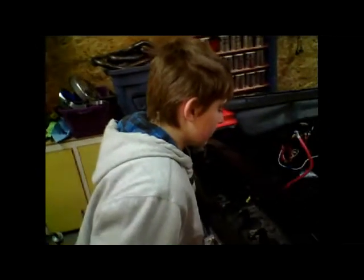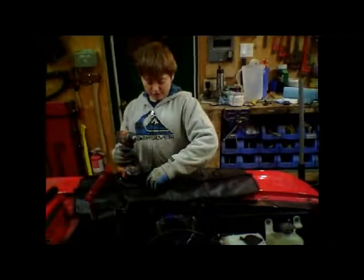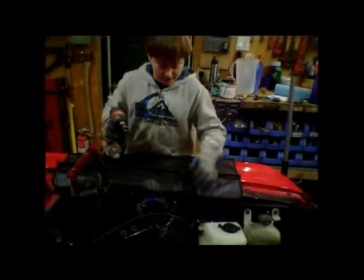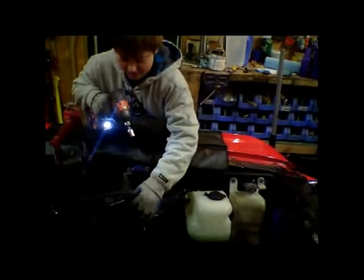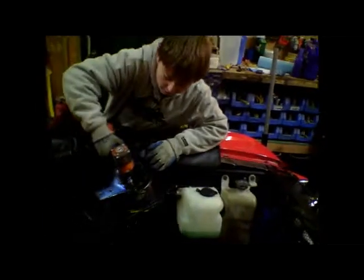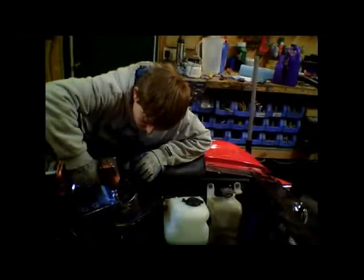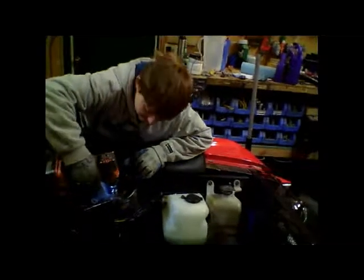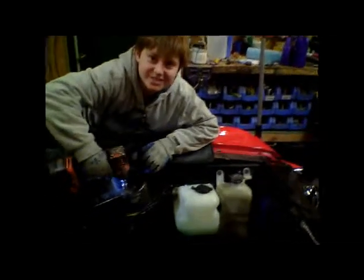We're pulling the transmission, and I just put the car on jack stands underneath the frame, and we're gonna pull the transmission. Okay, so we just pulled the transmission out. There it is right there. And now we're testing fit on the export brace to see if it's gonna fit. We're not sure if it's the right one or if something in the engine bay shifted, so I'm just taking off these shock tower bolts just to see if it fits. Oh, stud spinning. Just give her.